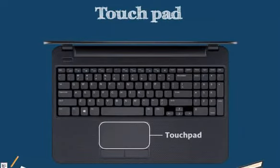So our touchpad on our laptop allows us to navigate the mouse without having to have any sort of additional outside mouse. This is the small pad that we'll find typically right in the center of our laptop, and again it is a touchpad and they can go bad. Depending on our particular laptop, we may have to replace our entire front of our laptop in order to replace the touchpad, or we may simply be able to replace just the touchpad component itself. We want to read our disassembly manual, take apart our laptop and then remove whatever type of cable, maybe a ribbon cable, that's holding our touchpad component to our laptop.